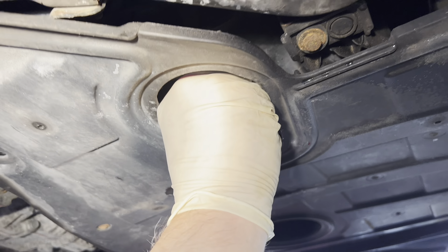While the car is up in the air, or if you're servicing it, you always want to check your tire pressures and give the car a look over. Whether you're doing a 3,000 mile interval or a 7,000 mile interval with synthetic oil, you want to give everything a look over. When you get underneath the hood, you're checking belts, hoses, and all your fluid levels, air filter. We already filled up the tire pressures on this and made sure it doesn't need to be rotated — they're good.